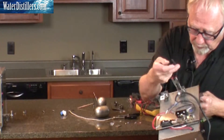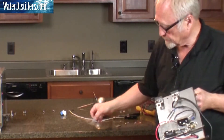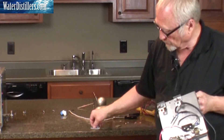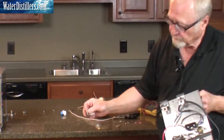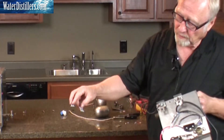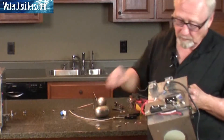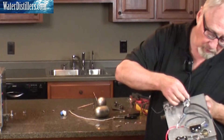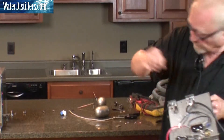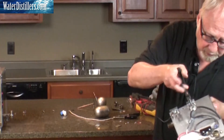You push them down in place. Now there's two gaskets. You will see here one's a little bigger than the other. You put the little one on first. And then the cutout areas are to kind of sit over the two nuts that hold the main bracket in place.